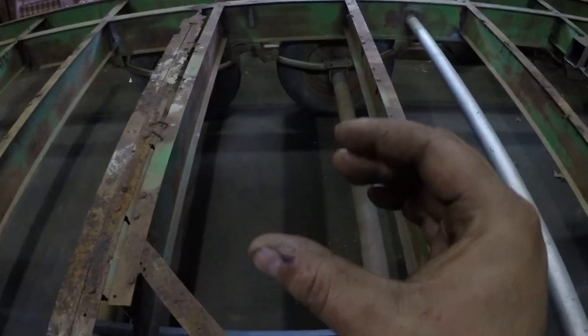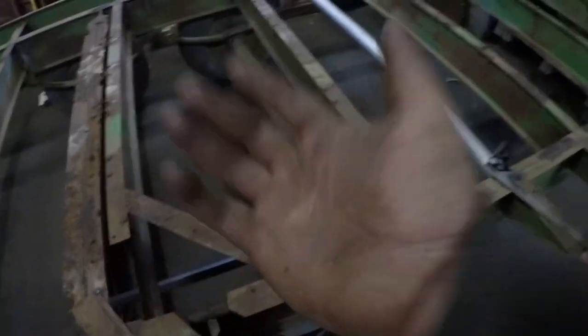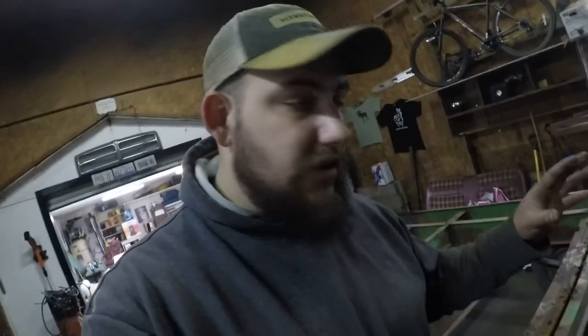Then I'm gonna go through and bust all the bolts out after I jack and support the trailer — jack everything up and out, wheel this whole assembly out, and then recheck my squareness. Then put maybe two or four more bars across just to maintain spacing. Once we've got our spacing dialed in, we can pretty much weld it anywhere. I'm gonna triangulate not off the hangers but off the axle bearing races — that's the one constant that's never gonna change going down the road.